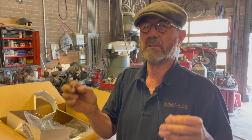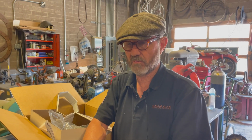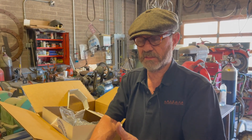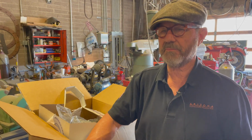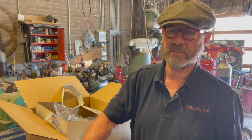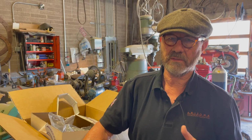Yes, I drive a 38. It has mechanical brakes. It takes more attention, more expertise to keep mechanical brakes working properly. You can make them work. But if you jump into a car, we have a 39 here that has 4-wheel disc brakes on it, and then jump in my 38, there's no question that car stops a lot better than my car. You kind of drive differently with one of these cars. You don't run right up behind somebody that's going 75 miles an hour. You give yourself some room to stop, because you're always thinking, I may have to stop.